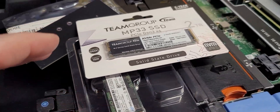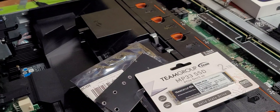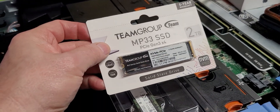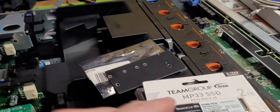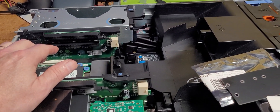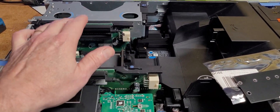NVMe is extremely powerful, very fast, and can saturate any bus we have in the industry. That's why NVMes have problems with bandwidth — only a couple of them can really be paired together correctly on a PCIe version 3 or 4 bus and still give you the performance levels you expect from NVMe. When you start adding more NVMes to the equation, the reality is you don't see anything more — it just stays the same because the interface bus has been saturated.